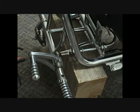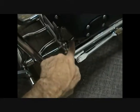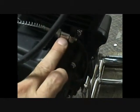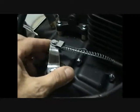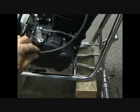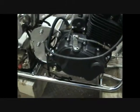The last thing we did was install the foot clutch, which seems fairly simple and straightforward. We noticed the clutch cable is fairly taut against the side of the motor — it goes underneath, takes a hard left turn, rests tight against the motor, then goes into a holder with an adjustment. As you can see, pushing the foot pedal works, but you'll definitely need to do some modifications to clean it up so the cable isn't sticking out and doesn't get knocked off.